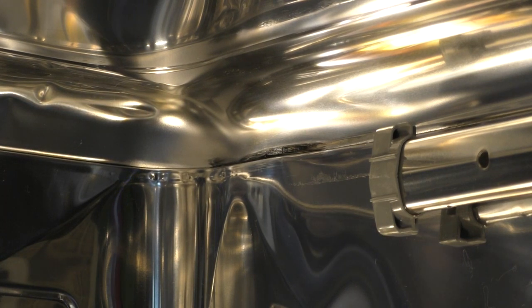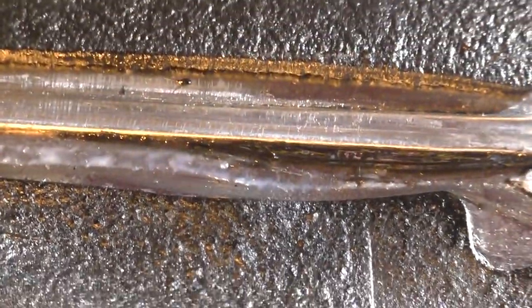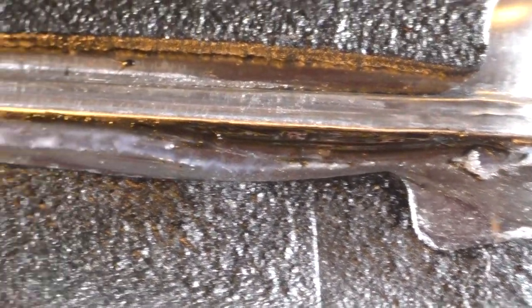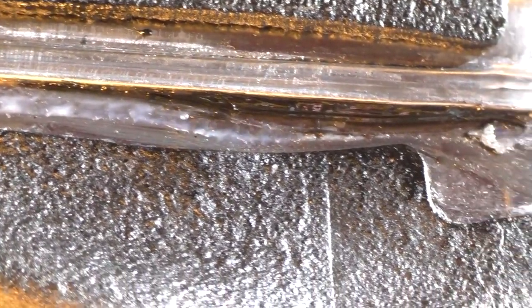You don't have to make a mound on the exterior with the sealant, but you want to try to fill in as much of the gap as possible to prevent voids in between that could leak. After the sealant is applied, you just want to wait about 24 hours before you use the dishwasher so it can set properly. Well, there you have it. I hope you enjoyed this video — if you did, please hit that like button and consider subscribing to my channel. I have many more videos to come. Bye-bye.